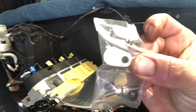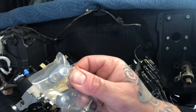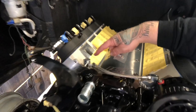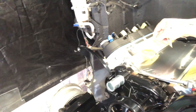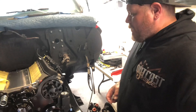Now as you look into the valley of this engine you can see I have to remove this tape and it leaves just a little bit of residue. If I pull it slower it's not as bad, but I don't want any of this on the surface of the heads before I put my intake on. So I purchased some Goof Off — we're just going to put a little bit on a rag and go around real slow and work that out. Then we'll take a rag with some acetone and a microfiber and just clean it all up, make sure it's dry.